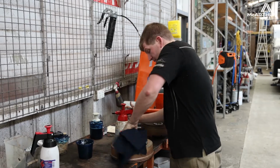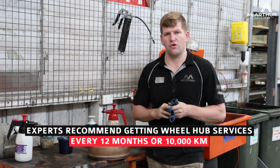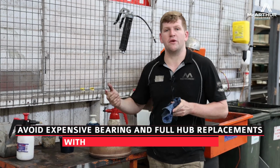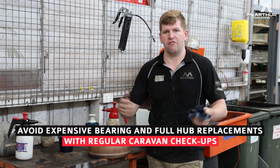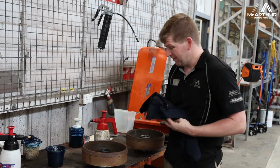So what I'd advise you guys is to try and get your van serviced regularly. We advise every 12 months or 10,000 Ks, whatever comes first. And you'll avoid problems such as getting new bearings all the time and any other further down the track that you might have to replace a full hub. So we advise you to do this.